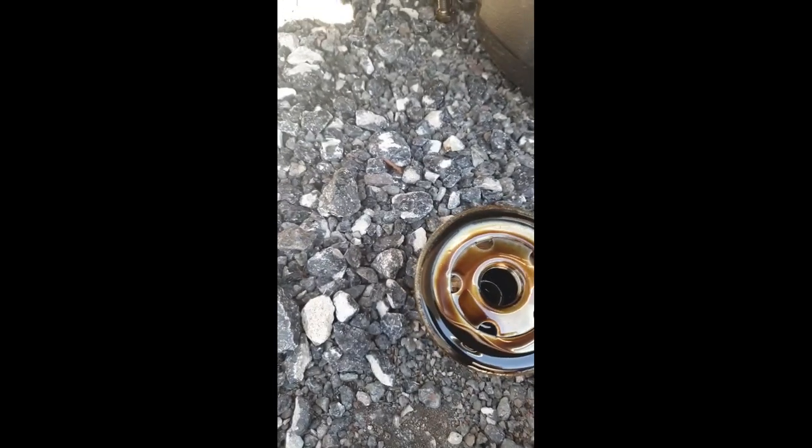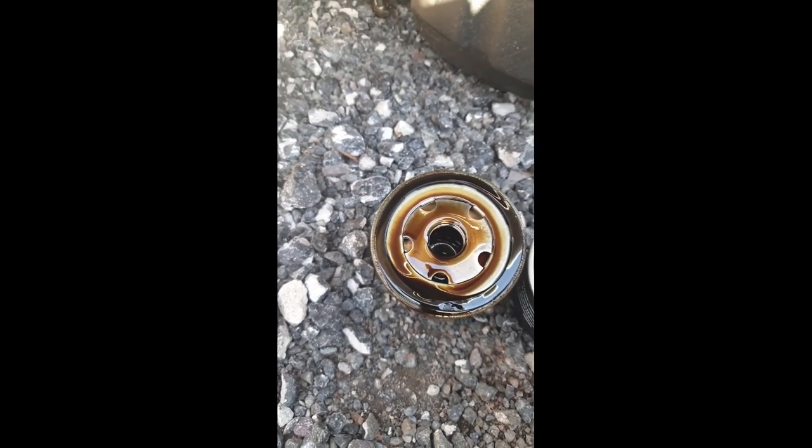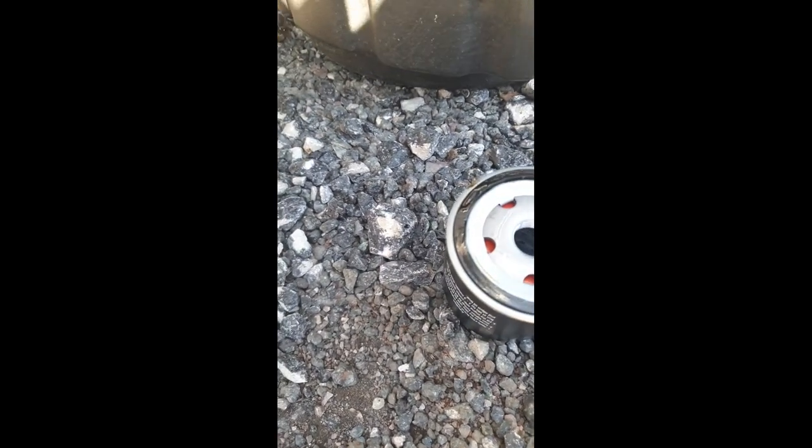Back again — there's the new oil filter, and there's the old one. I always check that it looks similar, but you're going to know straight away if it fits or not. All I do is grab a bit of oil and go around on the O-ring seal of the oil filter. Then I'll just clean off around that oil filter housing — it drains straight into the sump on this one.